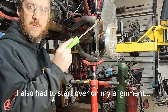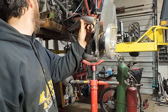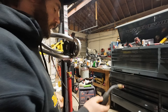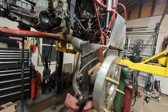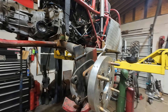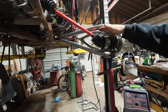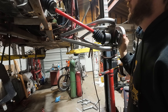I need to extend the base plate and move the arm up to make clearance for the CV boot. With 100% penetration on a 3/8-inch plate, a little extension there should just get me the clearance I need. Now I've got a whole hand's worth of clearance — that'll do it.